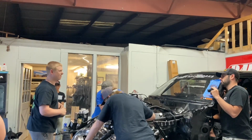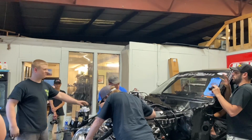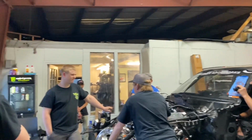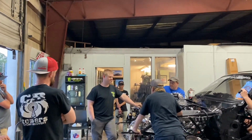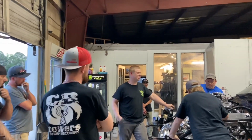So I feel like it's starting over only after firing 4. What you're saying is the actual position of the reluctor on the balancer will change timing if you change the orientation. Are we even sure that this is definitely a 1X cam gear? Positive. Yes. Okay. The cam wouldn't even work then. Right. It would be like an error. Yeah. And half of it is the whole pole. Yeah, it's literally like a half moon.